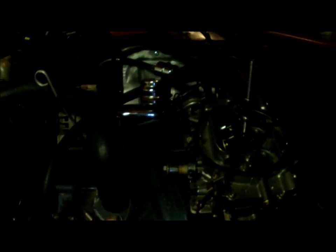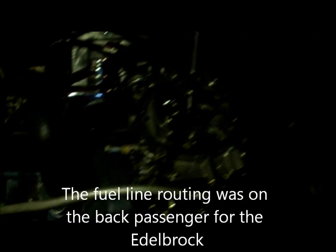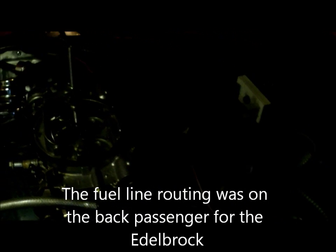Alright, so, I've already jumped ahead. This is my vacuum line to my brake booster, the vacuum brakes. On the Holley, the vacuum port's clear on the other side of the carburetor, so I had to run an extension hose. Again, I'm setting this up in a temporary means, good enough for testing. In case I want to go back, I can put it back to the Edelbrock. In case I want to go forward, all that means is getting in here and prettying it up. But for test purposes, I just want to get it to where it's in a functional and safe